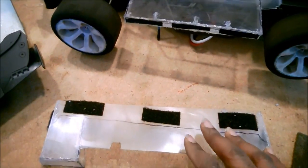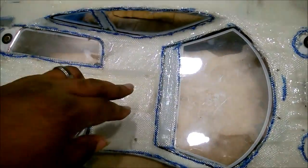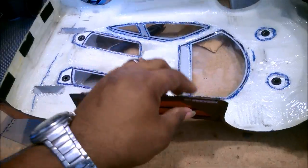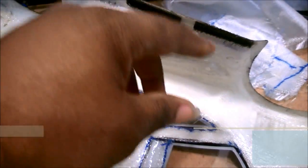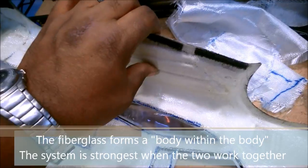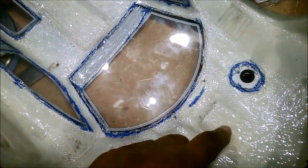Step one with fiberglass — when you're dealing with fiberglassing on top of classic parts, like I did with Dizzy's underbody, you're fiberglassing on to paint. The problem with this kind of setup is that the paint is the weak link in the whole mechanical system. If the paint starts to peel away, that causes a weakness in the whole system. The nice thing though is that we have all these molded pieces, so the Lexan body and the fiberglass body are joined by mechanical fasteners, which makes it a lot more rigid.